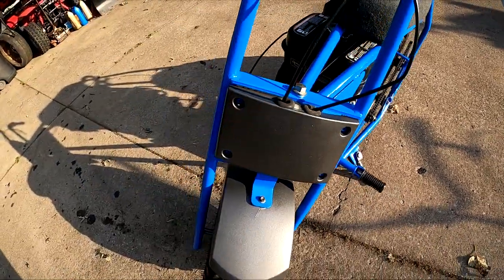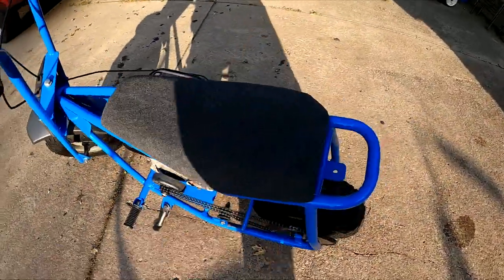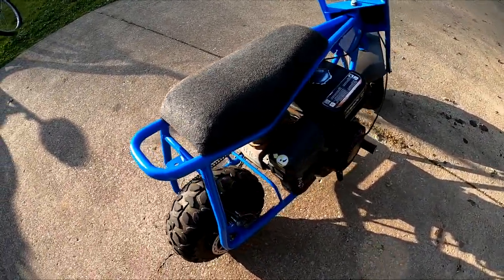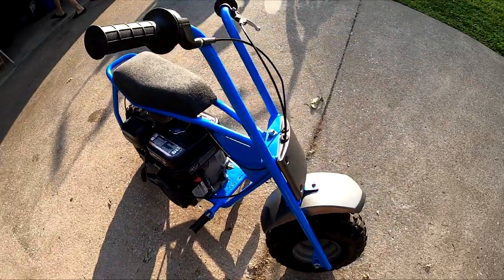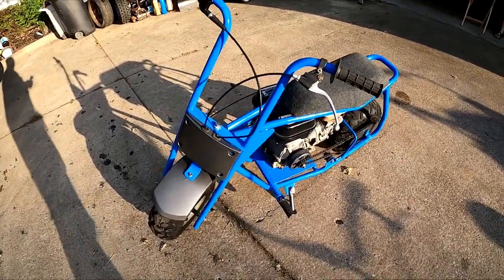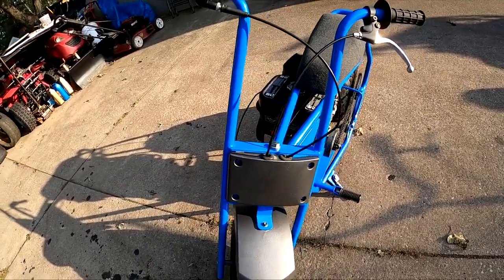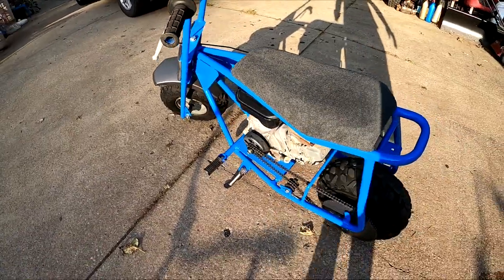We sanded down the whole frame. All the rust spots were treated. It was primed with red oxide primer, many coats of blue Rust-Oleum, sail blue, and some gray accents: the fender, the plate, the sprocket, the kickstand,